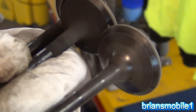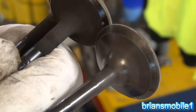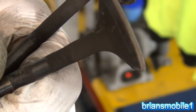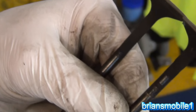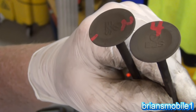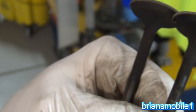If you've got them out, might as well clean them up. You saw how bad it looked before and now it looks like that — pretty good. You don't see a lot of scratching; it's just the cast look of it. The main thing we want to get off is this carbon buildup — this is what pulls down your valve guides, along with heat. Can you tell which one had a valve guide pulled down? These are both exhaust valves — E2S's — and yet you've got witness marks way up high on this one and way down low on the other. That's what does it.